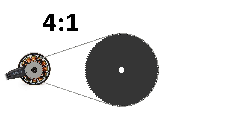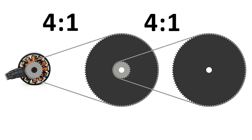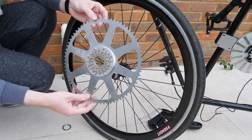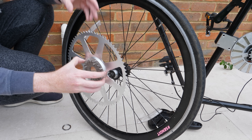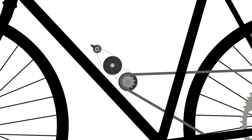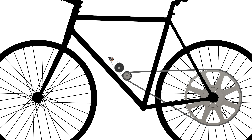Instead, we can use a series of belts and pulleys to bring the RPM down on the motor side before attaching the chain. For this specific application, I'm going to use a 4-to-1 pulley ratio straight off the motor and then another 4-to-1 ratio to the output shaft. This means the output sprocket will spin just under 2,000 RPM, and because my previous supercapacitor bike project required a large rear sprocket too, when combined with the pulleys we should have a final wheel RPM of around 360, which matches the e-bike perfectly.